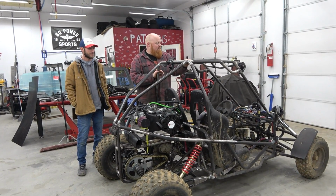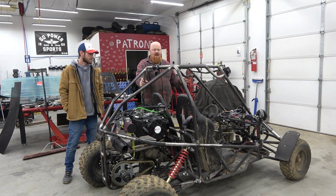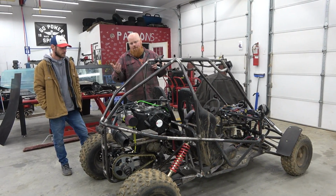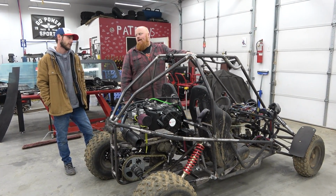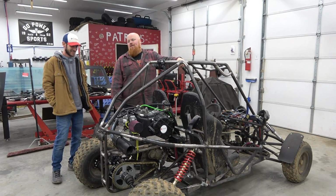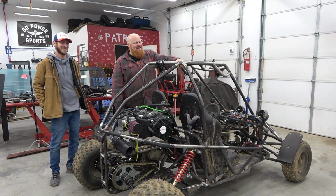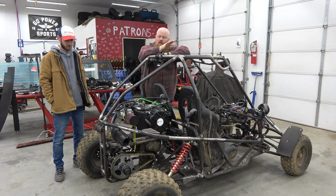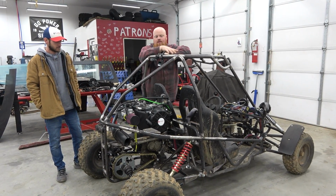A few moments later. So the last thing you saw me doing was building the battery box. Everything's running good. It probably needs jetted properly. We just rode my deuce. It needs jetted bad. It's rich and then lean, it's both at the same time. So everything's ready to ride. Nothing's finalized. This is just ready to do a good test drive.